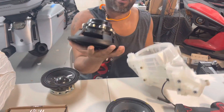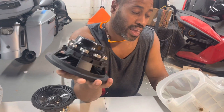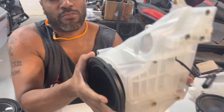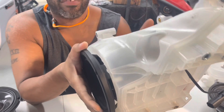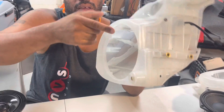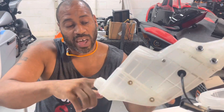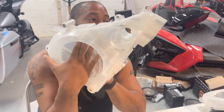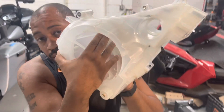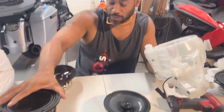The speaker that requires the most modification is the Bama Pro 6 CFMD. That one comes nowhere near fitting even after modifying the pod. You have to enlarge the opening about an eighth of an inch, and you're definitely going to require a Dremel to do that. You also have to take it all the way down to the back to get it to fit. We're not going to modify his pod for that since that's not the speaker he's running.